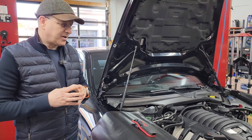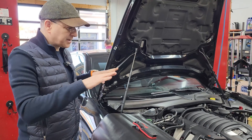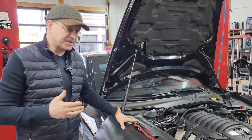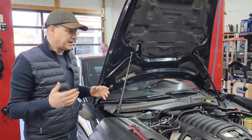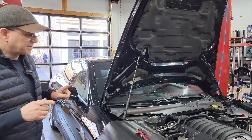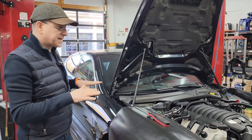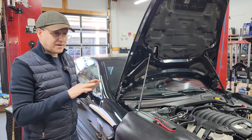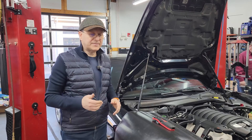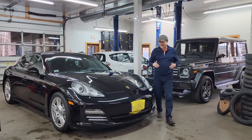It's Friday, so we're going to take the opportunity of the weekend and lock the car outside — it's cold, and suspension problems are most likely to show on a cold day. We'll park the car over the weekend outside on a leveled surface, let all the computers go to sleep, and then check back Monday morning.